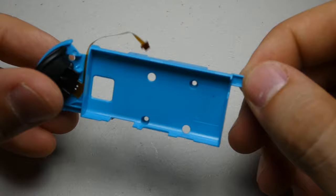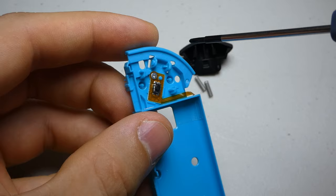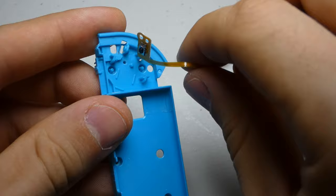Moving back to the old Joy-Con battery tray once again, we carefully wedge our thumb under the trigger button to unsnap it from its clips. Remember the springs underneath like to go flying, and they can be tough to track down. When all those bits have been removed, we can unscrew and extract the shoulder button cable and swap it over to the new battery tray.